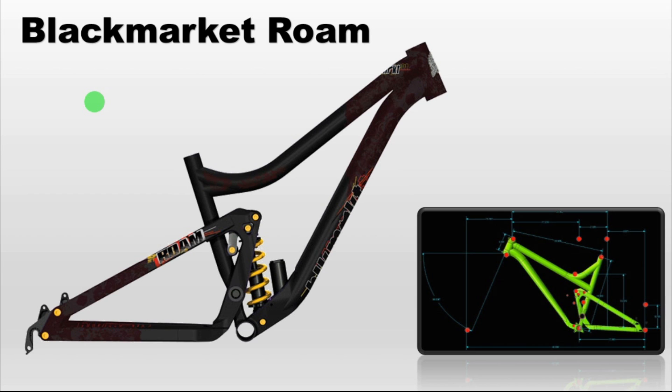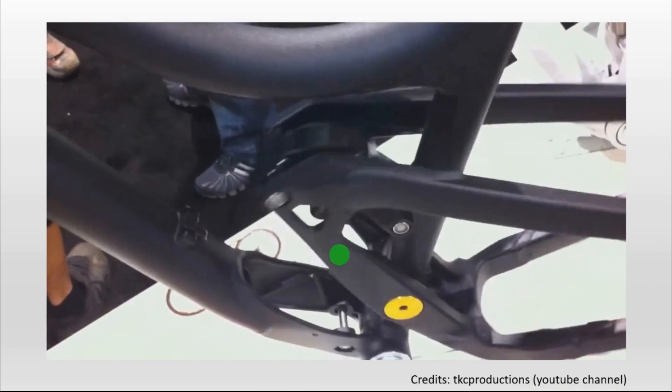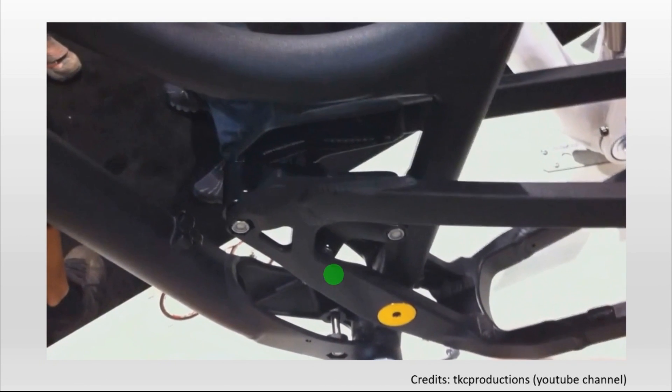Since this bike is so far the most progressive bike that I've seen, in the next slide I have a quick video showing how the linkage works — take attention to the shock rate. You will see that the shock moves quite slow at the beginning of the travel and then it starts to move really quick when the suspension is going to bottom out. See the rate of the shock linkage: the shock moves a little bit at first and then it moves really fast at the end. So this means that the bike is progressive.